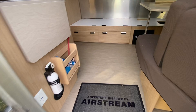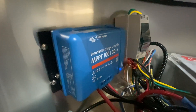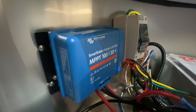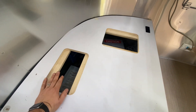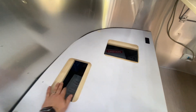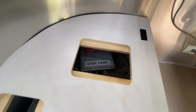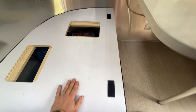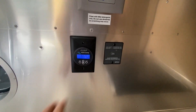Then inside — I'm going to save the best for last here. In here we upgraded the solar controller to the Victron SmartSolar, which works really well with the BMV battery monitor. We also added a disconnect in there. I'm a big fan of having a disconnect because it's just nice to know that the entire system is dead. We pulled all that stuff out and it wasn't too much trouble, and then we also replaced the converter with one that is lithium compatible.